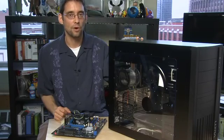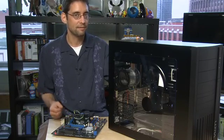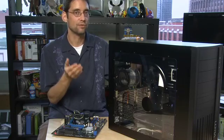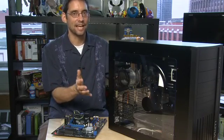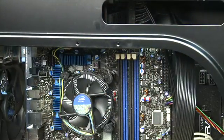Other things you want to check for when you're buying the case is that it has enough bays inside for the hard drives and enough bays for the optical drives you want to put in, and that it's easy to get to everything inside the case. You don't want a case that's difficult to move around inside and get your fingers into, because that would just be a pain.